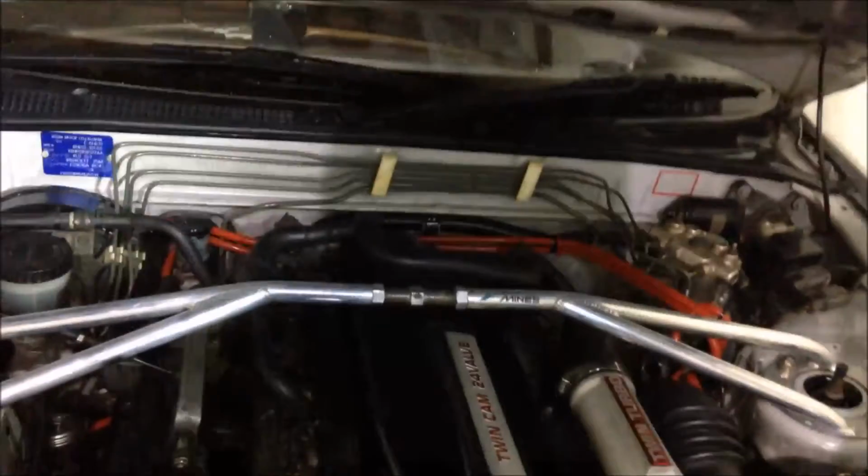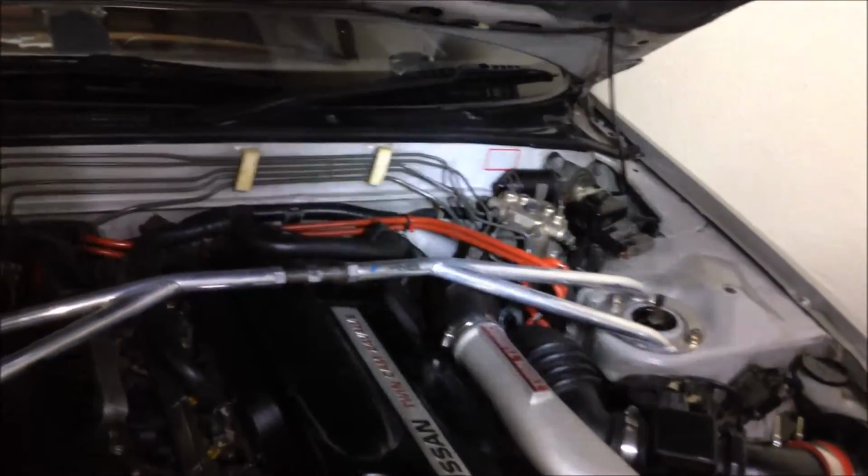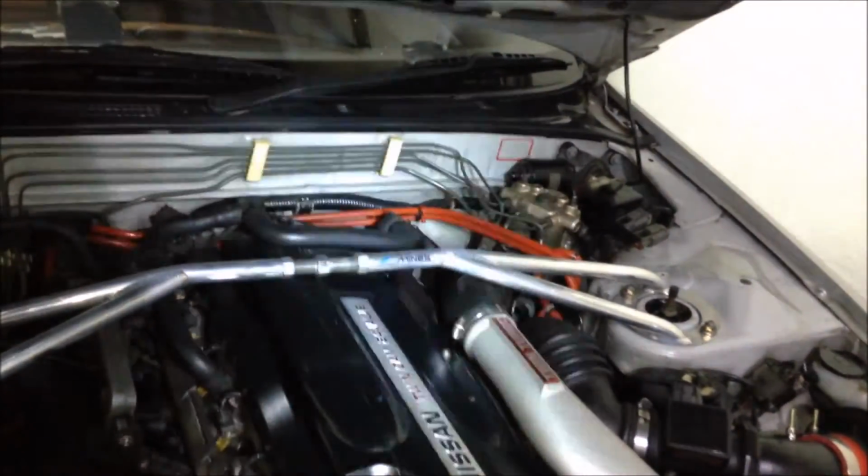Obviously, I need to get the car running nicely. Most of you have seen the other video that I had, boosting. The car's driving pretty well. Stock turbo setup, picking up speed very quickly. However, I'm gonna attempt to run scramble boost for a little while, possibly 5 seconds or so. I'm gonna attempt doing it in third or fourth. If you don't know what scramble boost is, it's a setting on the boost controller that will allow you to get more boost for a couple of seconds. So you can decide on how many seconds you want additional boost.